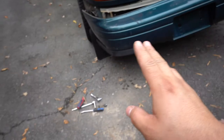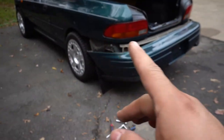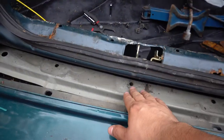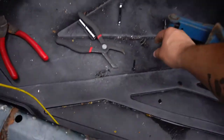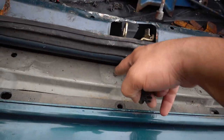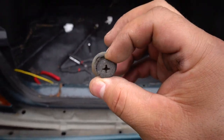And then the bumpers will be fully removable after that. But for now, we're just gonna do the side pins. I'm gonna leave, actually on the top, I don't think I'm gonna leave anything because getting in here might be hard. Either that or I'll put some better clips, because these are good if you're not gonna be removing it often, but getting a screwdriver all the way in here, at an angle, it's just not the move. So I'm gonna put some easier ones in there.